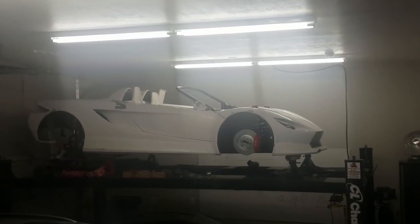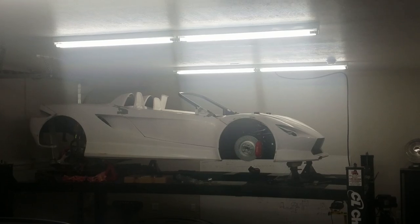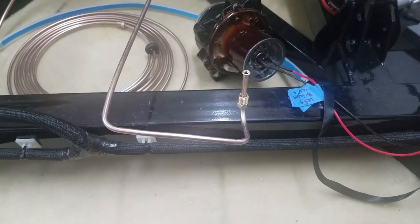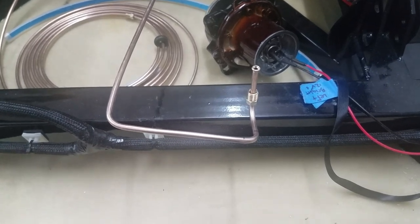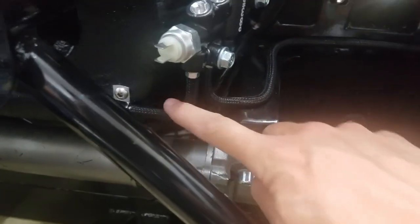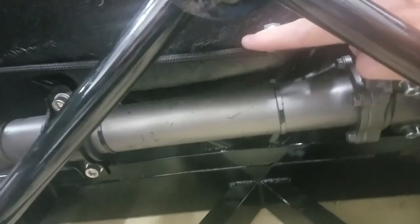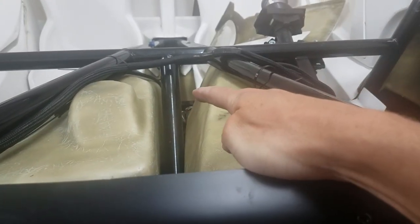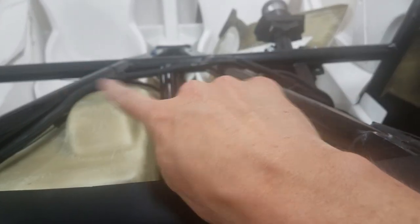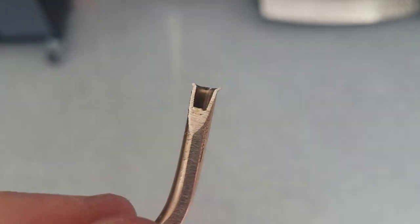This week we're going to start out by looking at the brakes again, doing some final tweaks, and then starting on the Tesla motor cooling. I am starting on the rear brake line — I've got a flare, got my connector, a couple bends. The thought is it will come down here, across over there, and then go in through the firewall, kind of back down all the way back there, and that's where I'll put the T so the brake lines can go to either side for the back brakes.